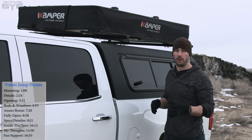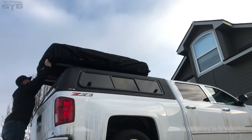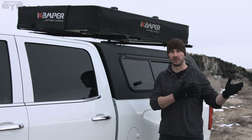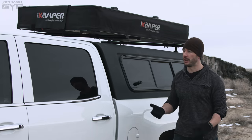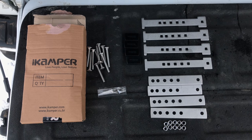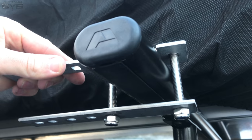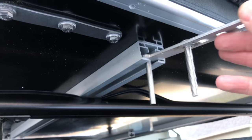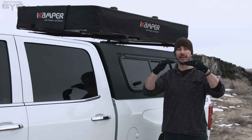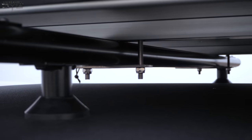Even a normal camper shell should be just fine to hold a couple people in this tent. Putting this thing on was absolutely simple. The entire tent itself is only 104 pounds. Attachment points are stupid simple — there are 8 nuts, 8 screws, and 8 base plates. You slide them into the sliding rail system of the X-Cover, bolt down the nuts until that bottom base plate starts to bend just slightly, and that means you have it torqued just right. Make sure to do that evenly on all four corners and you're good to go.